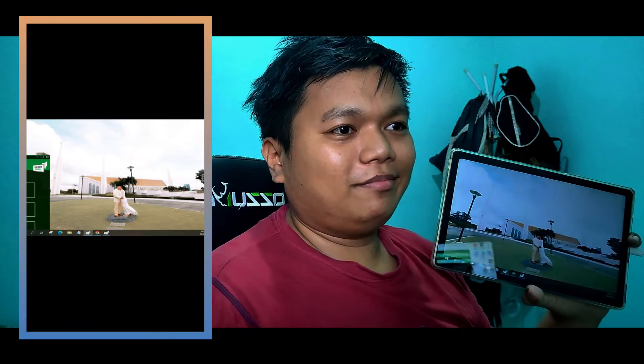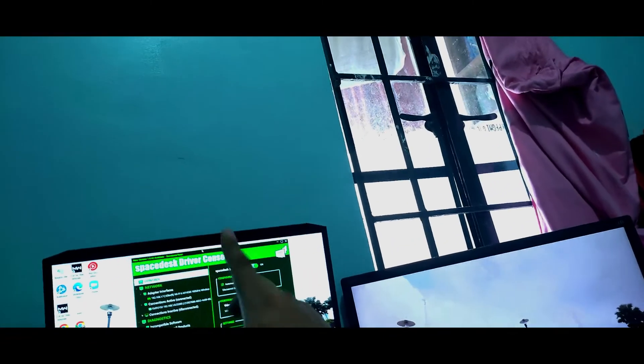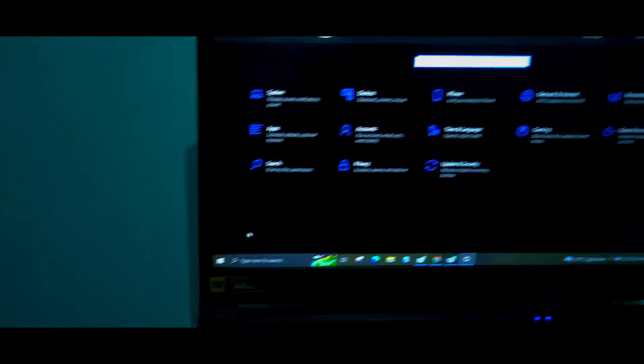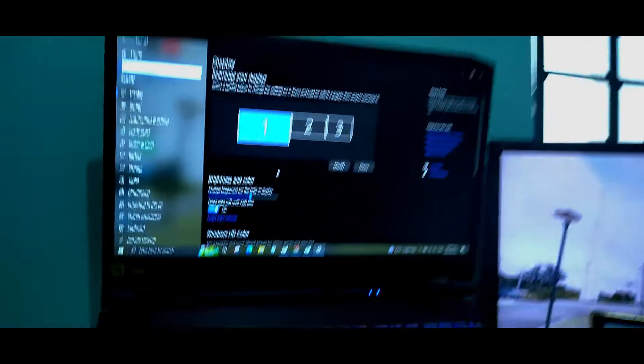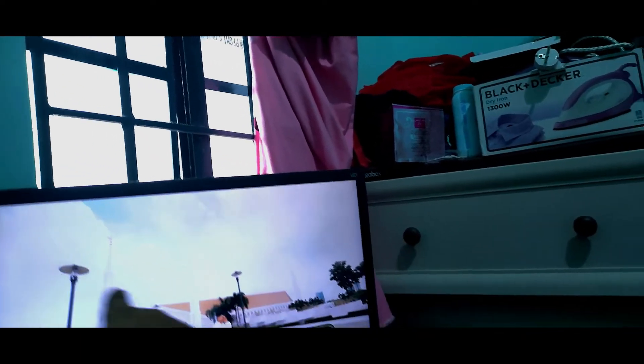Boom — and now we have it. Currently it is showing. One thing I'd like to note is that the first time you connect this, it might be showing the same monitor display mirrored. What I'm talking about is that when you connect this to your laptop for the first time, the display here and the display here might be the same. To fix that, head to your display settings, look for your display options, activate 'Extend' to this display, make sure that multiple displays are activated, then identify and set the monitor positions — for example, if you only have two monitors, set it accordingly and apply.